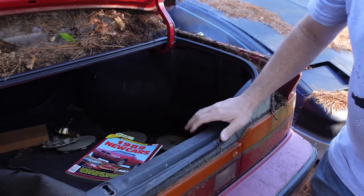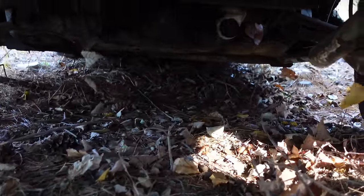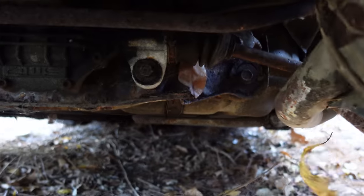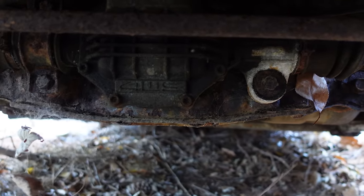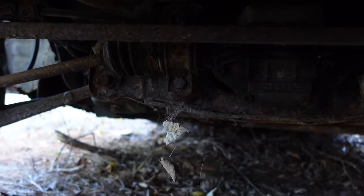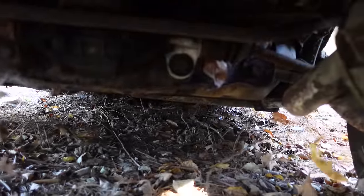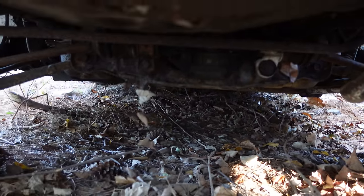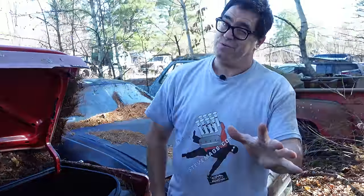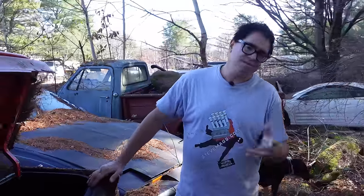Let's poke our noses underneath this thing. This is not electric and not hydraulic — it's purely mechanical. You can see the steering rack right there, located where a differential might go, with steering links to each rear wheel. There's a rod that comes from the front steering rack — basically a driveshaft — that feeds into that rear rack. There's a gearbox inside, sort of an epicyclic gear, that allows the rear wheels to steer left or right. At low speeds, the rear wheels can steer up to 5 degrees against the front tires. At high speed, that gearbox allows the rear wheels to steer with the front tires up to 1.5 degrees, reducing the tail-wagging yaw factor — mostly useful on wet roads and on the racetrack.